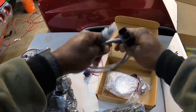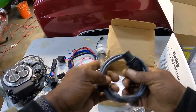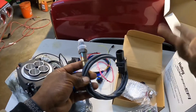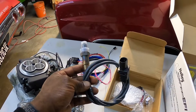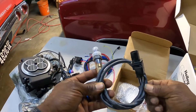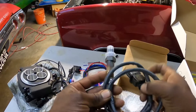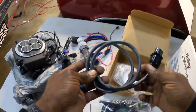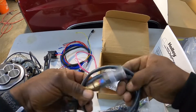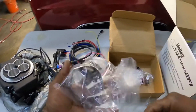This is your wideband O2 sensor — this thing is magical. It can tell the computer what your air/fuel ratio is and what your vehicle is doing currently. When you're in auto-tune or auto-learn mode, it allows the computer to adjust to conditions — like if you change altitude, temperature, or if it's running a little rich or lean. Those adjustments happen automatically, which is a big plus on any EFI setup because it helps you get a better tune.